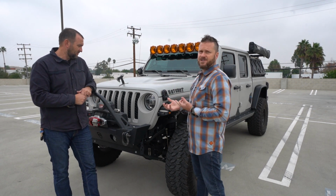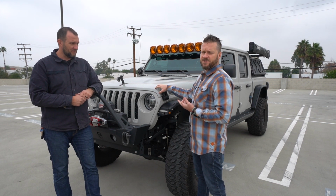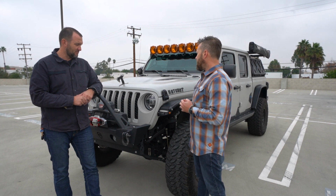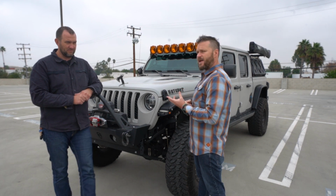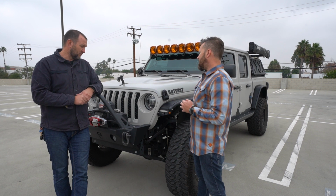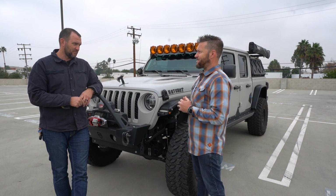They can do paint matching. This one is, I believe, called Crayon, which is a Porsche color that we decided to go with. It's kind of a grayish tan. You might not be able to see it in this light, but it's shot with the color OEM single stage, and then cleared over top for UV protection. But it's pretty bulletproof, and it's going to be with the vehicle for the rest of its life.